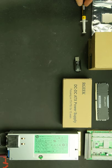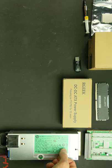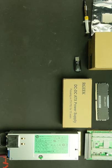For our power supply, we're going to be relying on an HP 1200 watt max output running on a 200 to 240 volt circuit. Be aware that if you only do a 120 volt circuit, you're only going to be able to get 900 watts max out of this for this model. All the links will be in the description below.